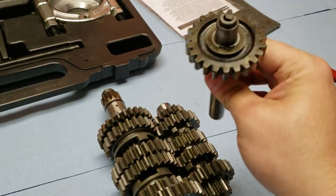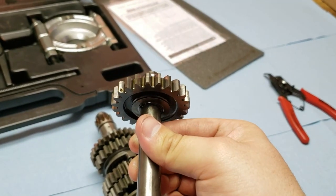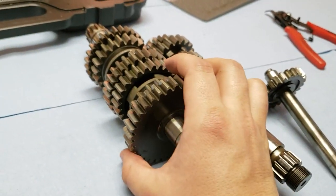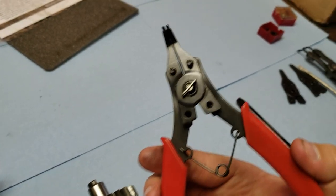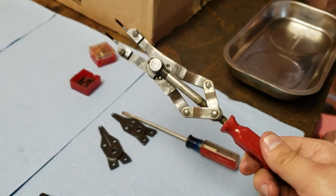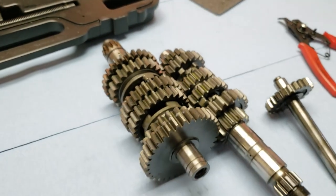Now for the shafts, as you can see, the counter axle just has a simple snap ring on it, and then the gear will come off of the shaft. For the drive axle, all of these are not pressed on, but you will have a couple of snap rings on there, so it's best to have some snap ring pliers with you of different sizes, just in case. I have a different one here that I've also used and it works pretty well for not losing your grip and having the snap ring snap out of there.